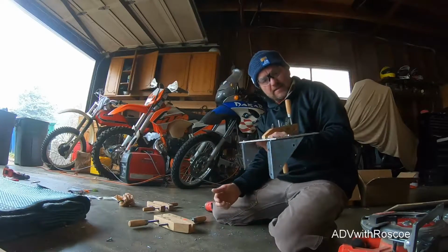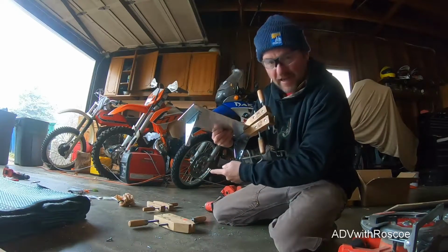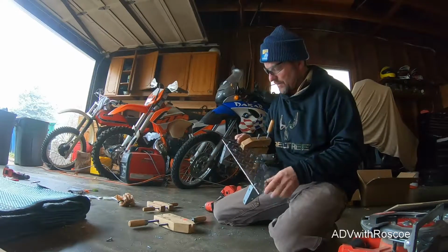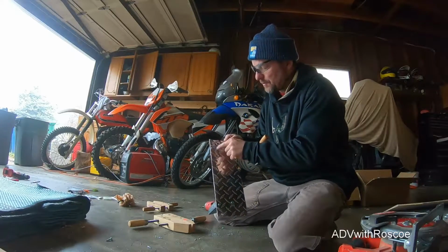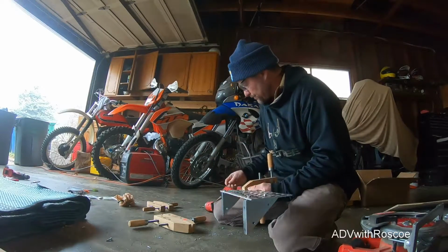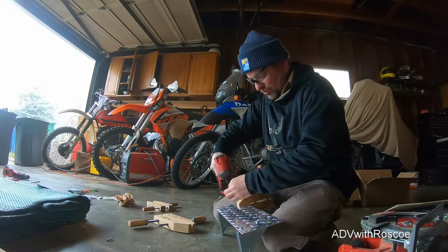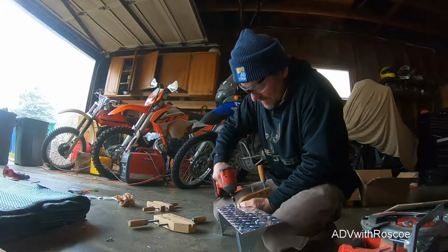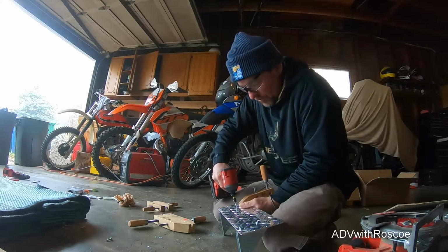Okay, I'm building a bracket to set it on. It's gonna set here, the exhaust is gonna come down and then out the side of the camper. So this is my bracket, some aluminum diamond plate I had kicking around. It sets up high enough so it won't rub on these screw heads. So that's the first step, build this bracket and get the holes cut out for the exhaust. And yeah, hopefully this works.